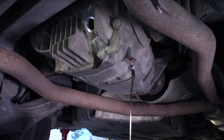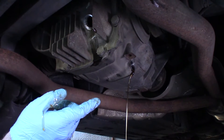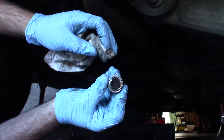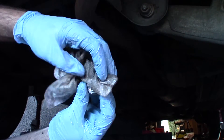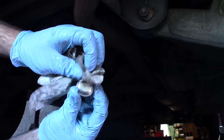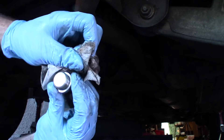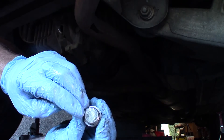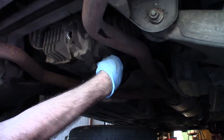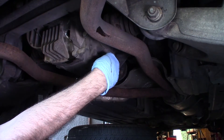This is a hundred thousand mile vehicle, and you should keep in mind this vehicle sat in a driveway for five years as well, so the oil definitely had time to oxidize — but it's still not too bad. I'm still glad I'm changing it. Here's what the plug looks like — it's got a little dirt. It might be magnetic to catch the filings that come off the gears over time, and these drain plugs usually are — so you want to clean that off. It definitely is magnetic. We're down to a couple of drops at this point, so that's good.